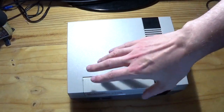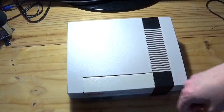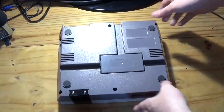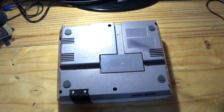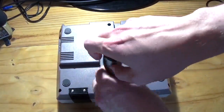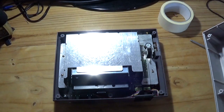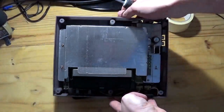So clearly we've got some issues with this thing, which were expected and aren't exactly uncommon. I think the best thing we need to do is take it apart, as I really do want to get these parts off for retro brightening. First things first — make sure it hasn't got a cartridge in; it still has one, so we'll take that out. We'll flip the console over and put a mouse mat down for a soft surface so I don't scratch the top of the unit. Luckily these use standard cross-head Phillips style screwdrivers, which is not common for Nintendo products — I think this is one of the only Nintendo consoles that used stock screws. Once the screws are out we can lift the top off and see there's not an awful lot in here — it's mostly just RF shields and empty space.